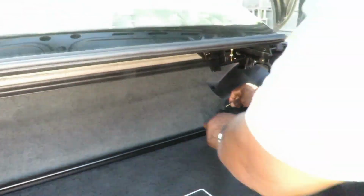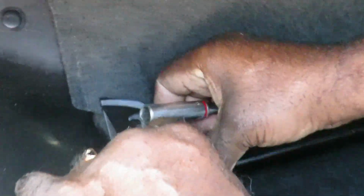We got our two 10 millimeter bolts. You know what was that socket head? I'm gonna use my 5-inch, 1/4-inch drive extension with my 10 millimeter deep. And let's get this part set down. Reach it over into this trunk. You want to start it off by hand a couple threads, that way you don't get it cross-threaded. Let's get the other side.